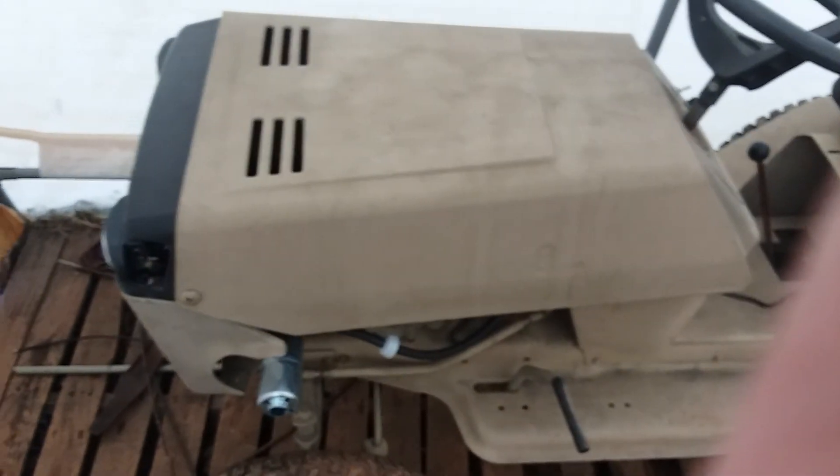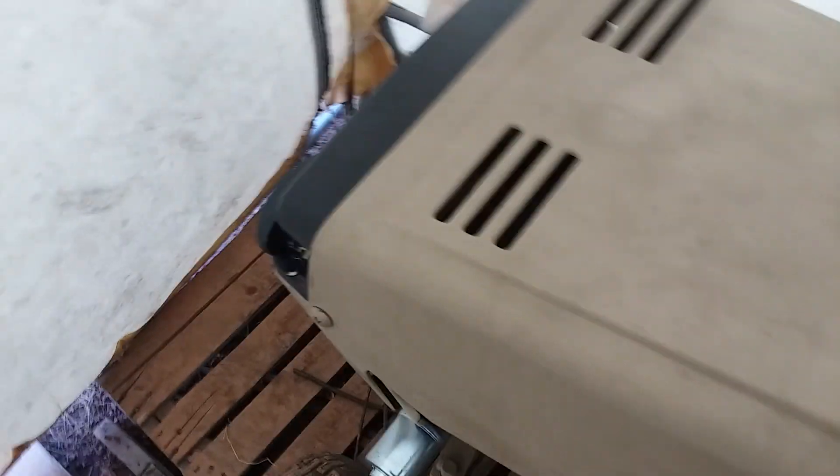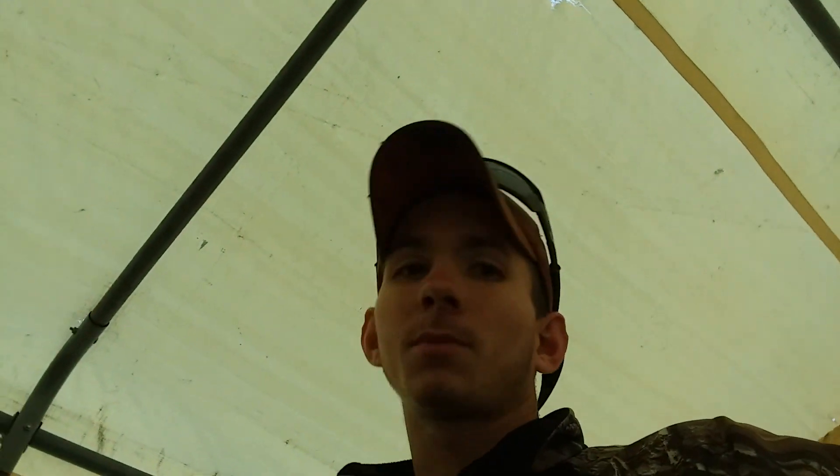That's why I did the exhaust the way I did. Standing still right now - I had to take the engine cover off. I found out by trying to crank it over that the magneto coil is bad, so I'm waiting to get one of those. That's pretty much all that's been going on - just working on little stuff until something big comes along. If you like this video please give it a thumbs up, subscribe for more content, got a lot of good stuff coming up!